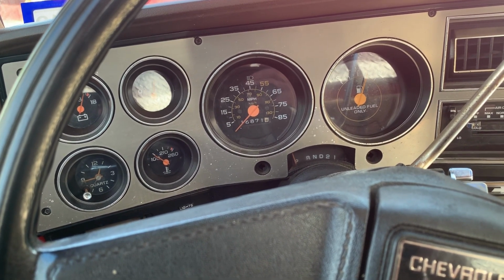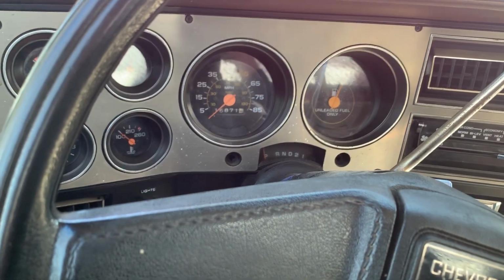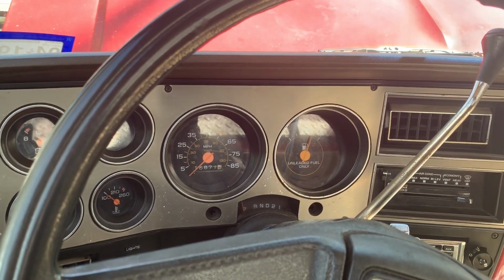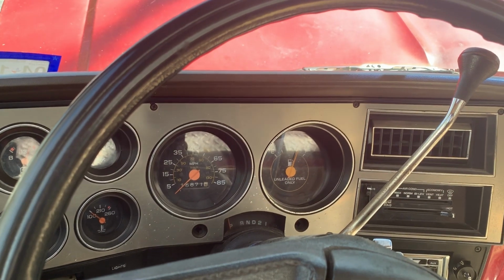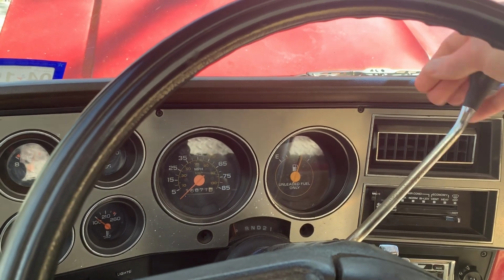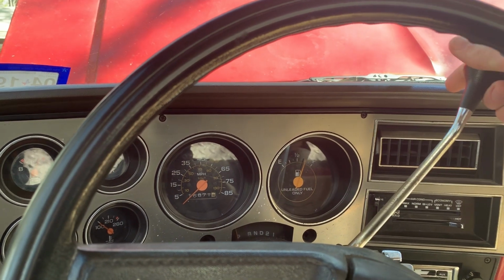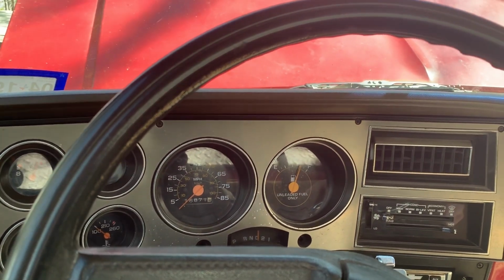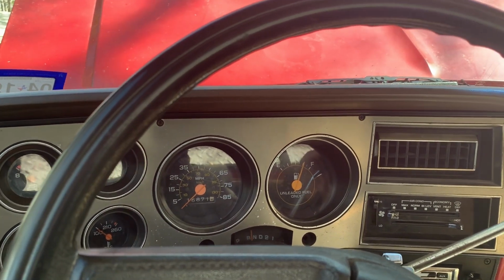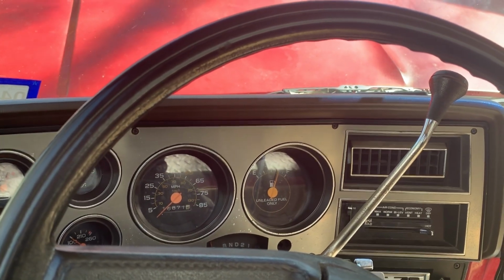The transmission converter leaks down through the pump. This pump is worn. When I rebuilt it, I reused the pump from it, and I should have used one of my other pumps. I've got three of these transmissions, so I've got three pumps. It's engaging pretty good, and normally you'll notice it in reverse. Let it sit and run for a minute, and then I'll check the fluid.